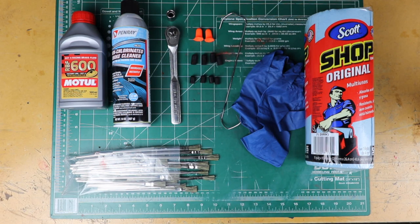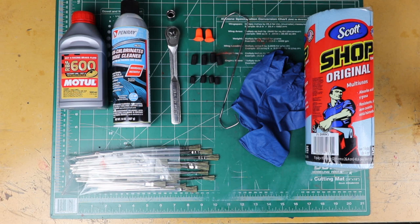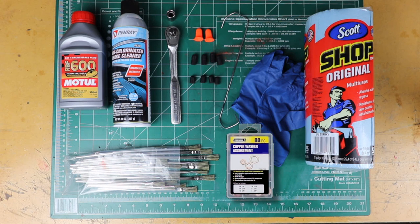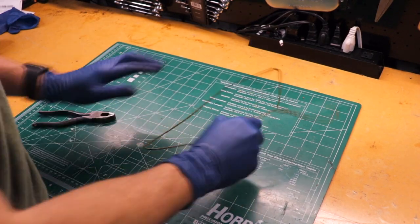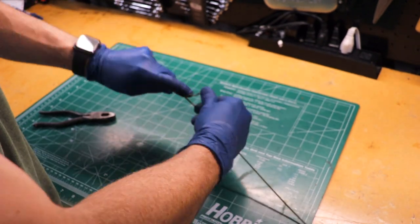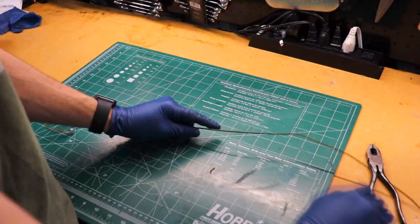There are a number of vacuum cap sizes out there so you might want to pick up a bunch just in case. Another way you can cap them off is with ear plugs, however I'm not sure how brake fluid will do with those, so have a backup plan. I hung my calipers up with hooks that I made out of hangers — this is the best way to get to all sides of the calipers while you paint them. The G2 caliper painting kit comes with one brush, but you'll want many, so pick up some extras — not too cheap. You can also consider getting a two-inch paintbrush from the paint department; it'll help things go a little faster. Generally you don't reuse the copper crush washers on the banjo bolts, so you'll want to get some more of those. To make S-hooks out of hangers, just straighten it out, cut it to length, twist up one end to double it up to make it a bit stronger, and then bend it all into an S-hook.